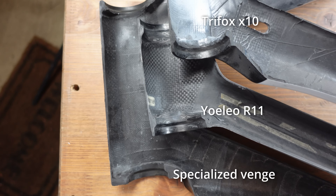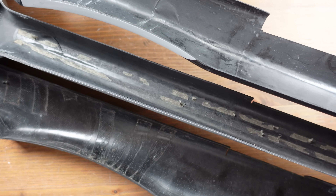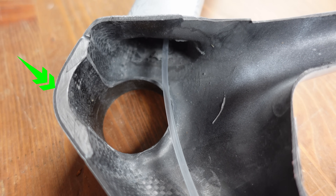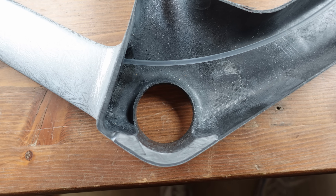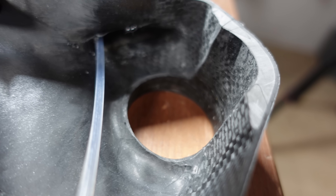Entering inside the Yoleo's down tube, we're met with a fairly neat picture. It's not boasting the biggest down tube, which means the walls can afford to be a bit thicker. There is a slightly raised section, but nothing to lose sleep over — we've seen much worse in other frames. There's an interesting bit of tape inside the top tube. Rob said these are likely adhesive strips holding the internal formers in position before air is injected to pressurise the shape — not something he had seen before. As for the bottom bracket, the Yoleo has an intriguingly larger section with what Rob described as a solid core base, likely to stop over-pressing and crushing the bottom bracket on press fit. It might add a few grams, but when it comes to strength versus weight, the strength wins.